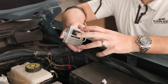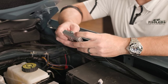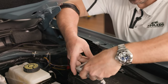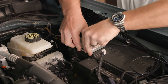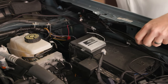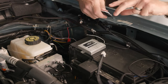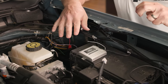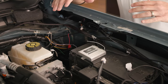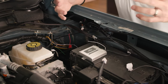The last step is hooking up our switch. We're going to be using a wireless switch today, which is optional. There's an automotive-grade adhesive on the back — we're going to stick it right here to this panel cover. Apply some downward pressure. This receiver allows us to control both lights remotely using a key fob like this, and it also enables strobe light function. Whether you're at a campsite or out in the woods and you're not in your Bronco, you can use this remote to turn your lights on and get all the light you need.